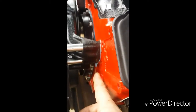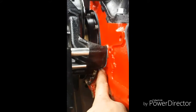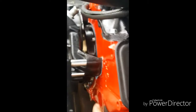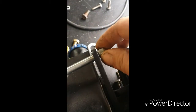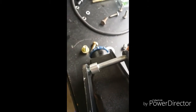So there are two options. You could spend some time with a grinder, if you had the right kind of tools, and just grind away at the block and maybe even a little bit of the water pump there, just to give yourself enough room. But I don't want to do that. What I actually had to do is cut the bolt down, because it would run into the block before the head of it even bottomed out on this side.